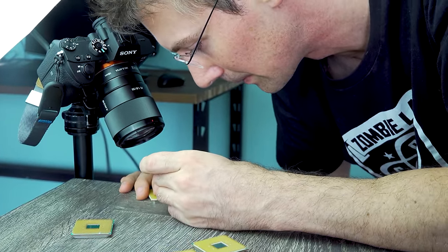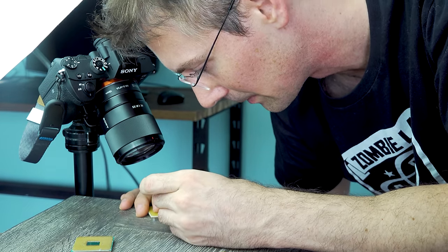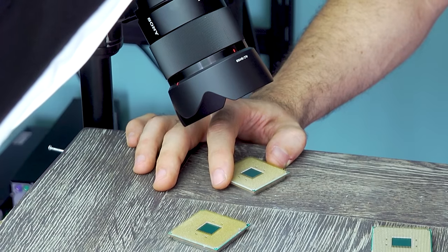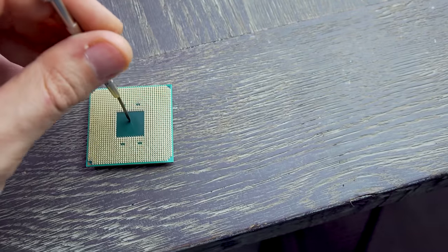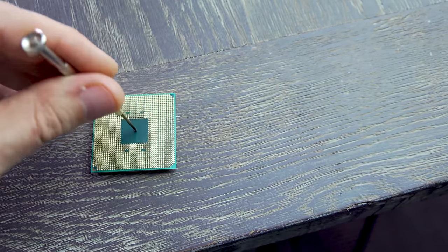But you can see already with the screwdriver method that we've got so much control, and that's what it's all about. We're not overbending a pin back one way or bending it forward one way. We're just taking our time. Not hammering it in, sorry. I mean, we're just putting it on the base of the PCB, and then we've got control over bending it any direction we want.